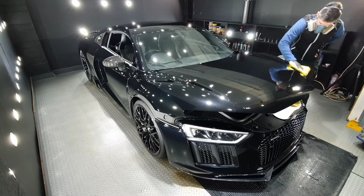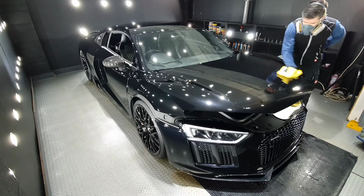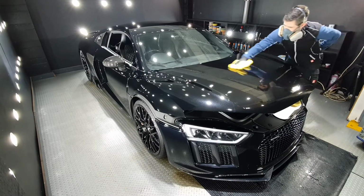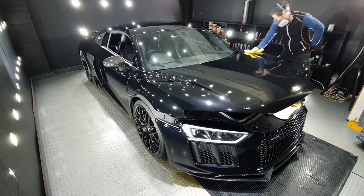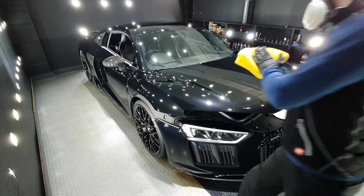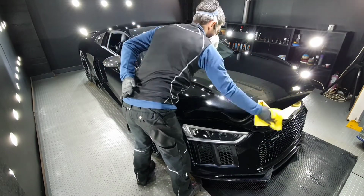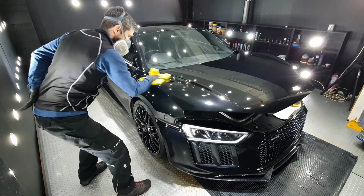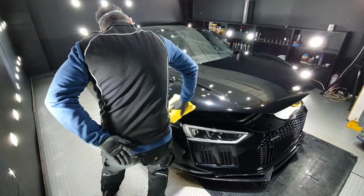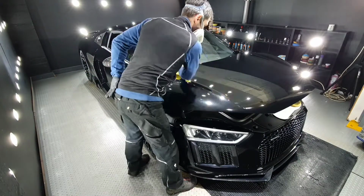Removal of Titan is as much of a breeze as the application, but this part is absolutely critical that you get it right. Should you miss a spot and leave a high spot, you will be left with a thick piece of coating that will either need to be machined or sanded off. My technique is to wipe away in straight lines, effectively leveling the coating further.